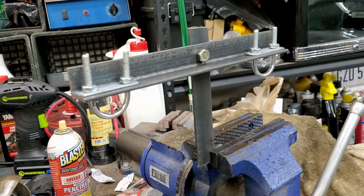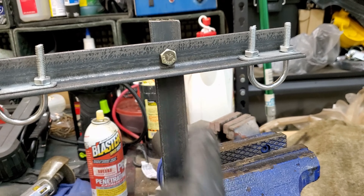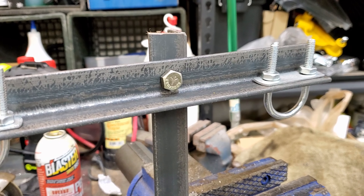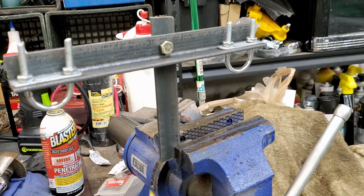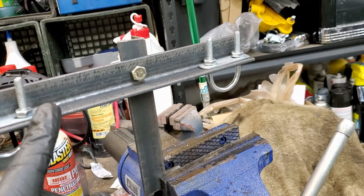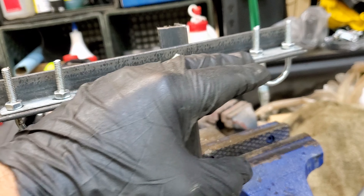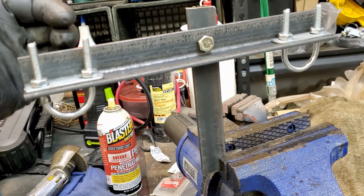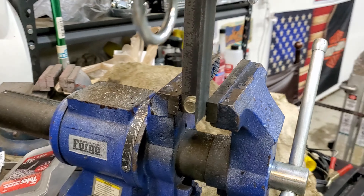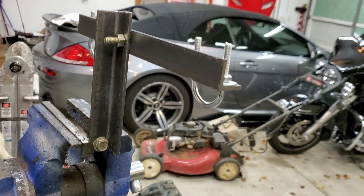I'll take it out — this is just a dry fit to see how everything's going to line up, and then I'm going to paint it and put it back into place. Here's the new bracket off the bike. Once I get it into place, I will spot weld the top, the sides, and the bottom to give it more rigidity. For now I just put it together with a bolt, because I needed it to sit in its most natural form with the diff so I'm not putting the differential in a bind. These are what I'll attach to the frame — this bar will sit up on top of the two frames behind my winch, and there's a bar that comes down here and a bar that comes this way to hold it up against the frame nicely.